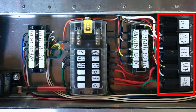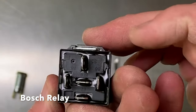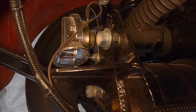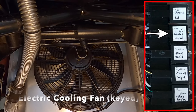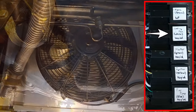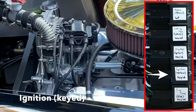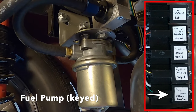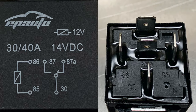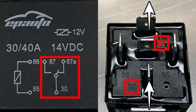The most important components in my fuse box are five Bosch relays. They're important for a number of reasons, but the main one is I can lock them out with a key and I don't need to run large gauge wire all over the car. I'm using them to trigger the horn, the cooling fan, the starter — which is locked out with the key so someone can't just start your car — ignition, which I can actually use to turn the car off with that same relay, and of course the fuel pump. The way a Bosch relay works is you trigger it with a low-amperage input like a toggle switch or push button, and that in turn feeds your load — your starter, ignition, cooling fan, whatever you want.